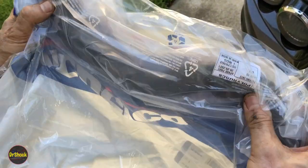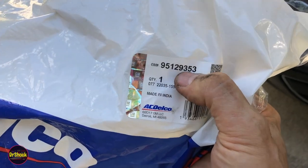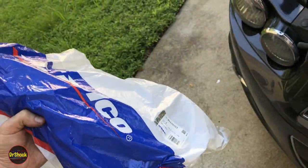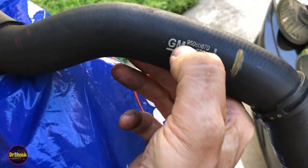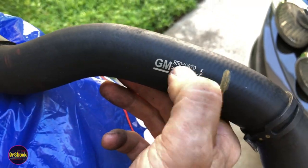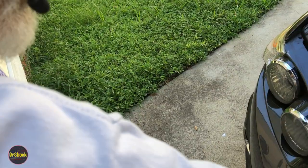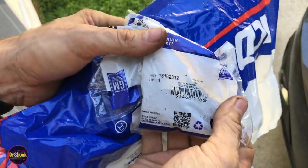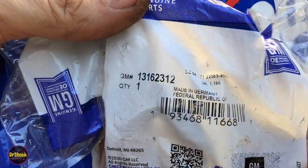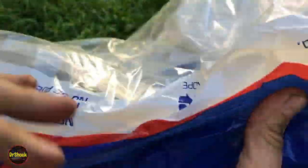Let's go ahead and proceed with replacing it. Here's our replacement hose — it's going to look identical to the one we're changing out. The part number is 95129353. The upper radiator hose from the factory has a different number — it's assembly number 95080870 — but this is the actual orderable number. Whenever you change one of these out, it's good practice to put new clamps on it as well, part number 13162312. It's basically the same type of spring clamp but a lot more healthy with a lot more tension on it.